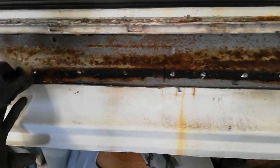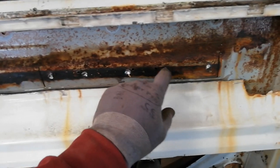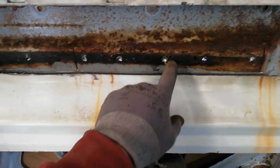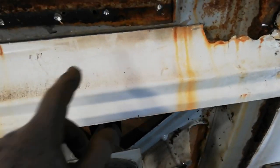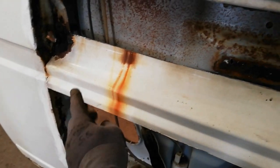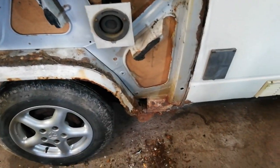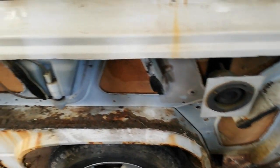So I just cut that top piece out there. It's actually spot welded to that all the way across. Found some spots, didn't see others - there's one there, and there's one right next to it as well. Same there, they both have one right next to them. I don't think this section here comes with my replacement panel. It might include this bit, but I need to keep this. But as you can see, it needs repairs anyway. For the time being I'm just going to cut it out. I'm really just cutting this quarter out now so it's out of the way to do the bottom repair, and it's going to have to be done, so I may as well just get it out of the way.